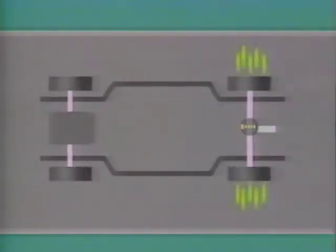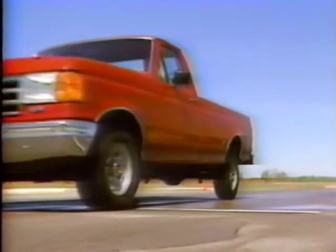As long as the rear tires continue to roll, some lateral friction is maintained, which keeps the vehicle tracking and helps the driver maintain proper control. The result is improved braking regardless of road or load conditions. Now, Ford's new rear anti-lock brake system essentially pumps the rear brakes, and much more effectively than the driver could ever accomplish. An electronic control module located in the passenger compartment continually monitors the speed of the rear wheels by reading a signal from a sensor mounted in the differential housing.